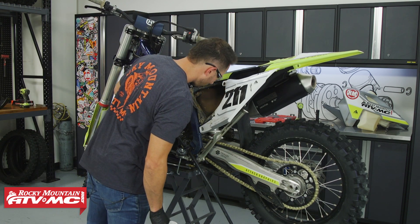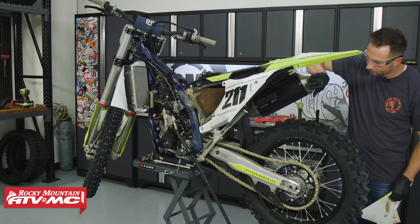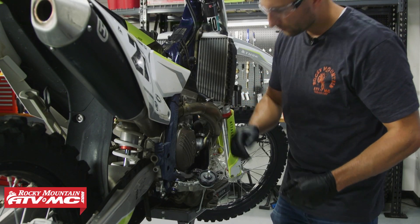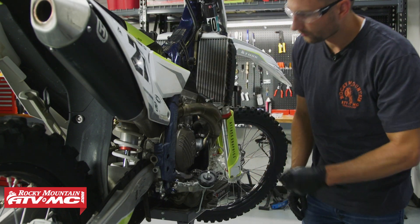Those leak locations are going to be places like your intake right by the air box, and you're going to listen by the exhaust — those two things are going to check your valves. You're also going to remove the oil fill cap or dipstick; if you hear a ton of air coming from there, that means you have air going past the rings and they're worn out.